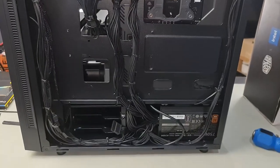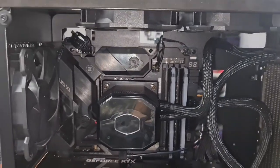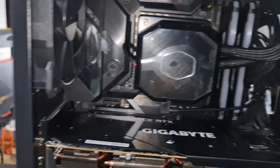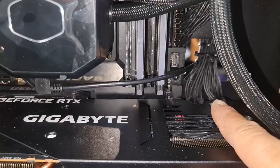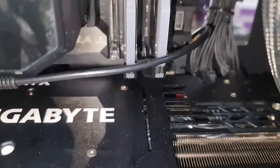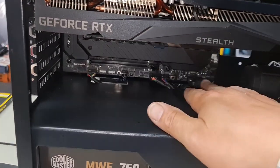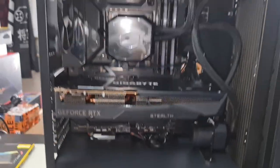We'll do one final inspection from the front and make sure we don't see any of the cables from the other side. All right, so now when we look through here, we make sure that we don't see any of the cables through the openings on the other side. Double check that the GPU cable has just enough flex, that it doesn't flex too much, where it might damage the GPU cable, but that looks fine just like that. So that's really good. Double check all your cables, one last check. Everything looks great. Pumps fastened.